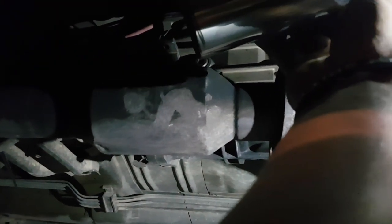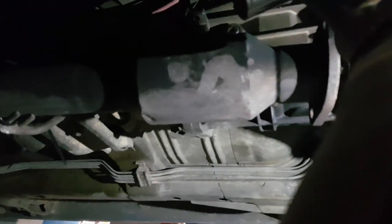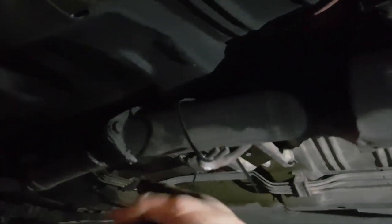So yeah, even though it's missing my exhaust, it's fine. So I'm gonna keep it down like that. I'll put a little 90 in it there. I'll trim this to the right length. But yeah, V-band there. I'll 90 it towards that way. And then I'll probably just move the cat further down for now, because it's too close, because the extractor used to be there. So the cat just has to be in there. I'll probably just cut that section out and pop the cat straight in there.